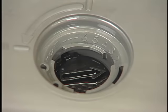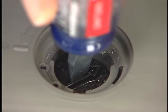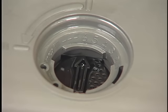The factory setting will give good results. If you have hard water and notice calcium buildup on your dishware, you may want to try a higher setting. Turn the arrow inside the dispenser to the desired setting.